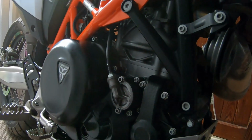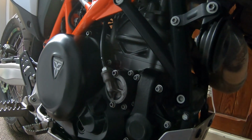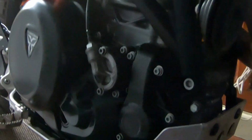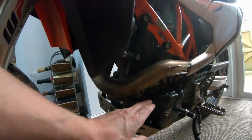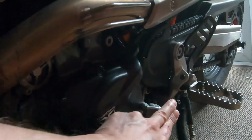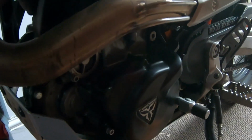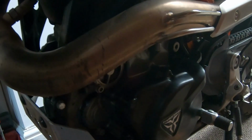But I have to say, I don't think the one on the other side is worth the risk, because it's going to trap dirt and cause problems. This side drains out and it's not so bad, but the one on the other side is probably unnecessary. It's a much tighter fit and goes all the way around, but it's not watertight, so I would probably suggest don't bother with that one. Your gear lever bends anyway if the bike goes over, so just something to think about. This is ownership experience after all. Just telling you how it is.